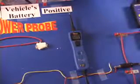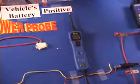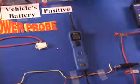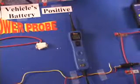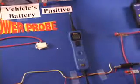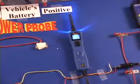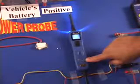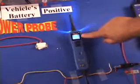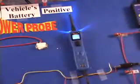We didn't intend this video to be a training tool for the Power Probe 3, but since we're on the subject of using it for open circuit signals, we'll touch briefly on a few important details. The Power Probe 3 will detect your open circuit signal because it has an invaluable feature built into its Power Probe mode. It has the ability to pick up circuit noise or signals, and you can hear them through the speaker. At the same time, it'll give you a peak-to-peak reading on the display. Some may know this peak-to-peak term as min-max.